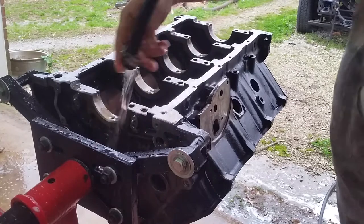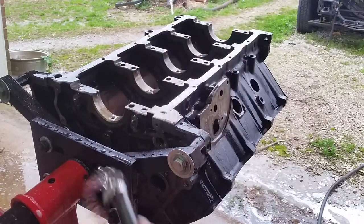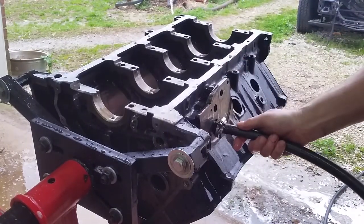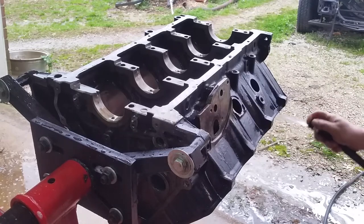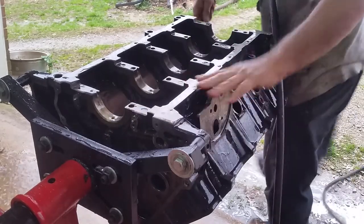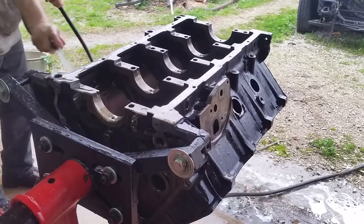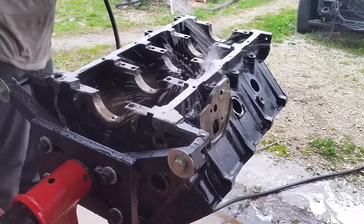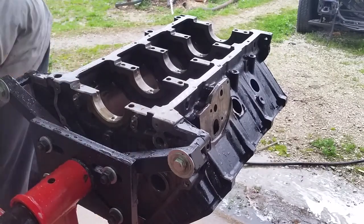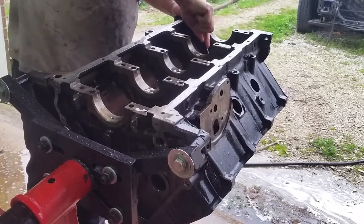I worked with a guy one time overhauling an engine. He went through cleaning this all. Told me he was ready to put it together, so we started putting it together. Got to firing it up. Started overpressurizing the radiator. Thought we had a bad head yesterday. So, after tooling around a little bit, I let her cool down and popped the radiator cap. It smelled just like Dawn dishwashing soap. I said, brother, did you wash the engine, right? Yes, I did. Okay. Did you rinse it? You mean I'm supposed to rinse it?